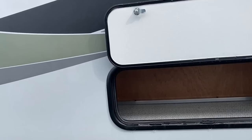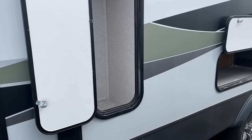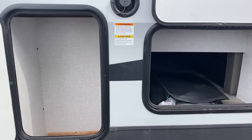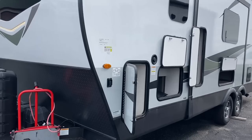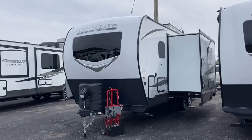I closed the slide up and we're going to get you some bonus footage showing you inside that storage area. Notice the dinette has a fully welded aluminum cage structure below it — that is just something this company does for anything that's load bearing, which I think is very cool. While we're talking about construction, the floor is actually one of the only non-laminated portions of the RV. It is a five-eighths tongue and groove plywood floor decking on top of aluminum joists running 12 inches on center longitudinally down the RV with residential batt insulation in between them, so you don't end up with chilly piggies.